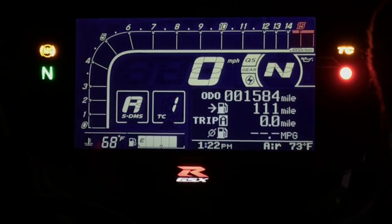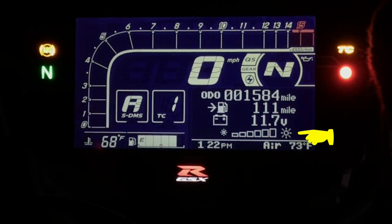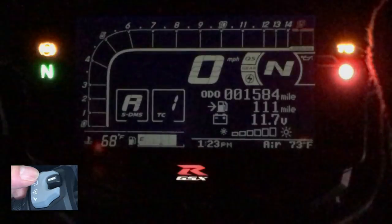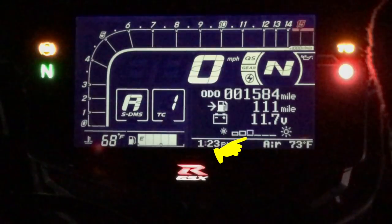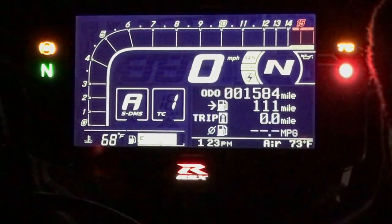To change any of that, use the menu down button to go to trip B, or to a third screen showing the battery level. The bottom part of that screen shows the screen brightness blocks. To change screen brightness, you have to be on this screen: push the menu up button and it goes to the dimmest setting, then keep pressing to scroll through to the brightest setting. You must be on this screen to change brightness; click menu down to go back to your trip screen.